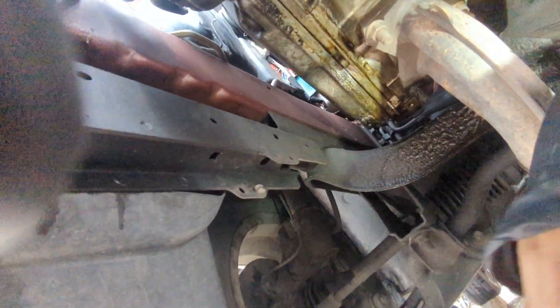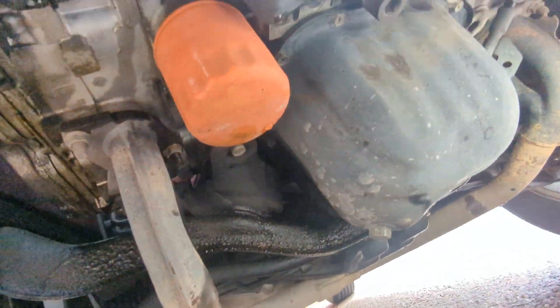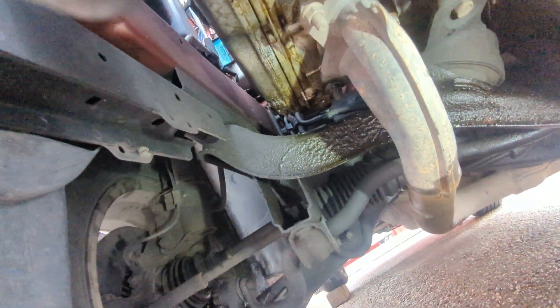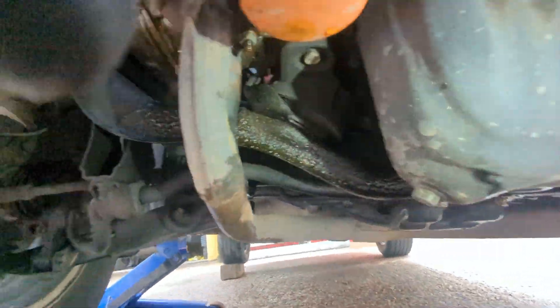And then another giveaway: we've got oil coming out of the head gasket, and we've got coolant on the side — looks like it sprayed back here. So this one doesn't really require any further diagnosis. We've got a busted timing belt, one head gasket on that side, and a little bit of leak in here. I think this one is a goner.